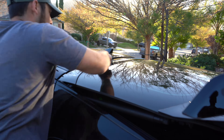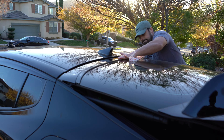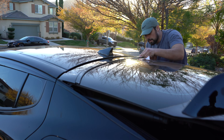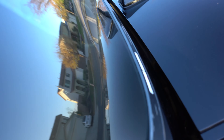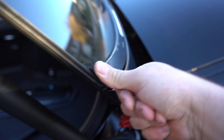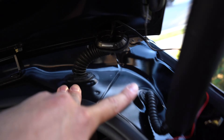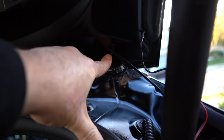Adding some adhesive to make sure this thing sticks. The LED brake light bar is on — this thing is solid, it's not going anywhere. The 3M tape on this thing is crazy. I fished the wire inside of this plastic trim here and now it's coming out through this end. I found a hole in the trunk where I fed a zip tie through, and that's where I'm going to be taping the wire so I can feed it through the little grommet at the bottom of the trunk — there's already a little area for the wiring there.